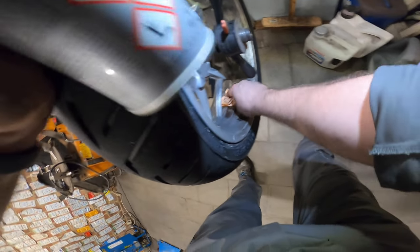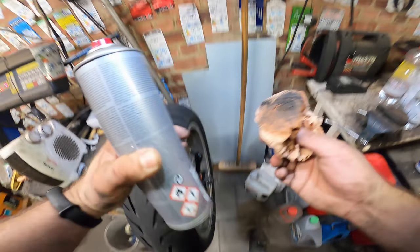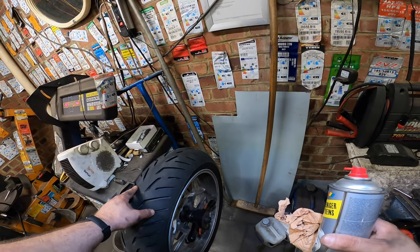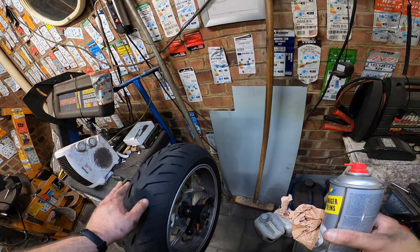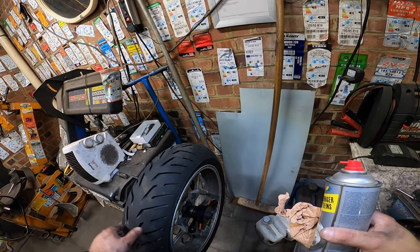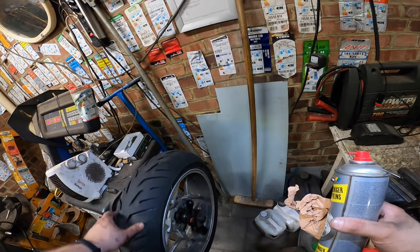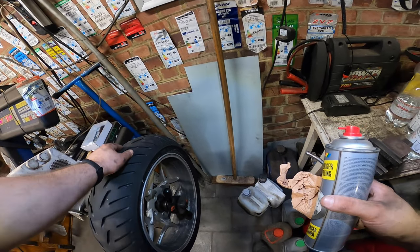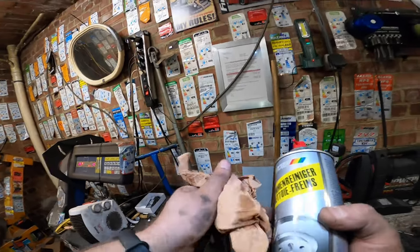And when you have the static, I think I have a video about it, with a static balancing motorcycle tire, you would just spin your wheel. Of course, this bearing has a little bit of resistance. If it would be really badly unbalanced, it would immediately turn to the heaviest point. And whatever the heaviest point is, it will be at the bottom, of course. So it would be like this, and then you would make a marking right over here. Turn your rim and put the weight on there.